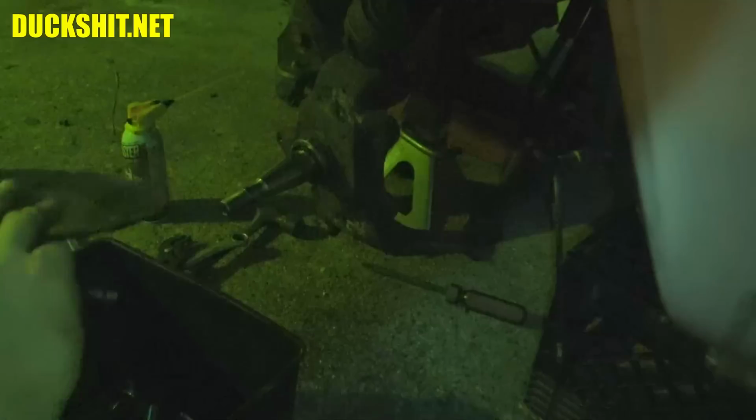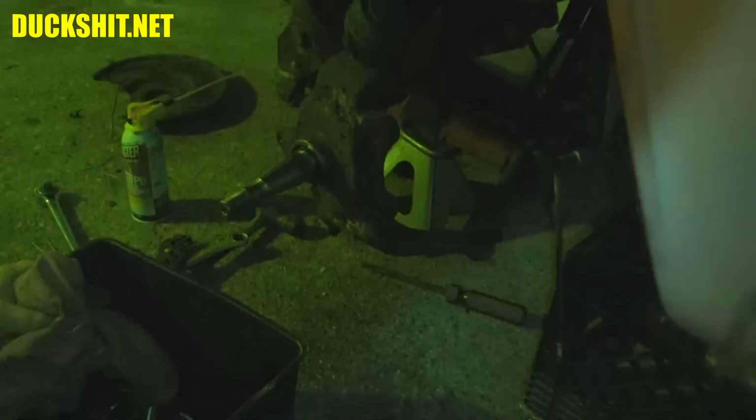All right, one backing plate off. There's our spindle. Now I can see some of the stuff that we have on here, such as our sway bar, which is bolted and strapped. Got a bolt right here and a strap over there, which you guys can't see, but I think I'm gonna call it quits for the camera. And I'm just gonna keep on bolting some stuff. And, you know, I guess the next major thing is gonna be the spindle bolts and the tie rod bolt. Once that's out, then it's a matter of pulling the arms out, but the arms are just a couple of grub screws and they pull right through. So if you guys missed that, nobody's gonna die, but you will see it when I put it back together.